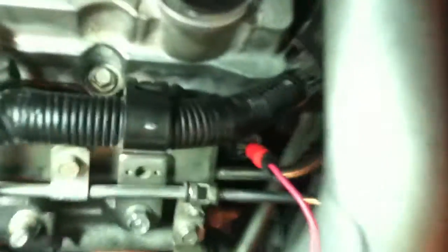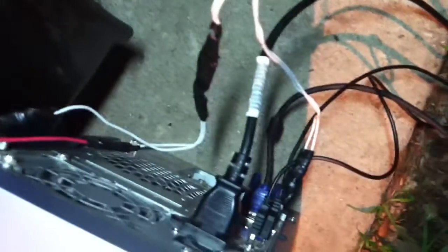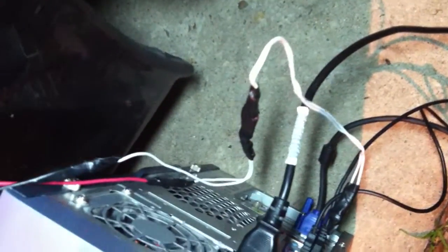Here's the setup. We have the sensor with a T-pin on the connector with this little clamp, which leads to my homemade voltage divider to step the voltage down so the sound card doesn't get fried. Then we have some scope software running here, and I'm about to crank it to show what it's actually doing — just to document that we've got a good signal.